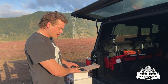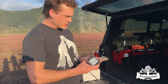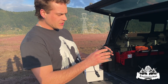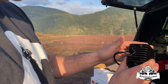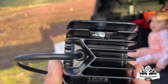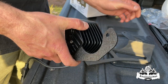Something really important here: you're going to want to put your LED cube lights on the mount before you mount it to the Jeep, or you're going to have a hell of a time getting these pod lights onto this mount. With all pod lights, you've got to let the little nut fall into the groove — there's just no way to do that while the mount's on the Jeep. Don't snug it all the way, just get them on there first.